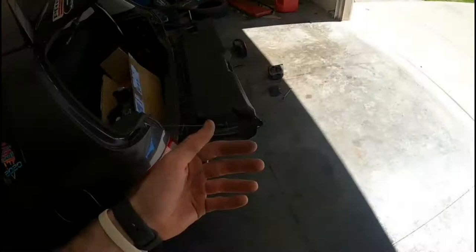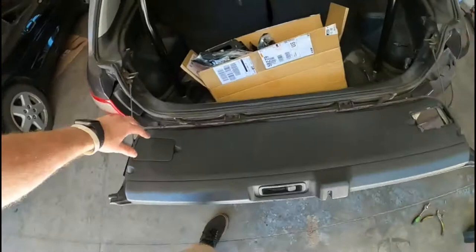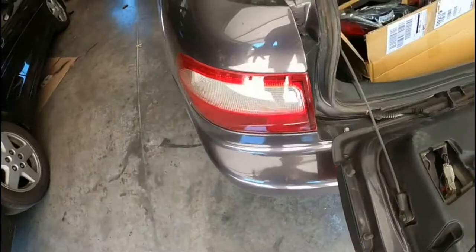What's going on you guys, I'm back with another video. So I bought some new tail lights - they're actual 50/50s. I'm in the process of uninstalling my old ones and figured someone out there might want to know how. To get the tailgate one off, there's a bolt right here and then these two bolts, along with all the electrical, and then it just pops right off. On these side ones there should be four bolts, but mine only held on by two.